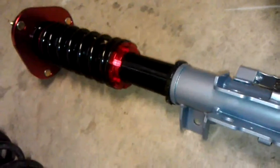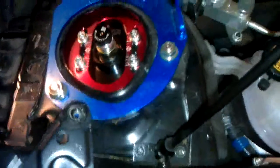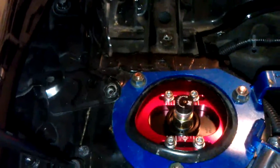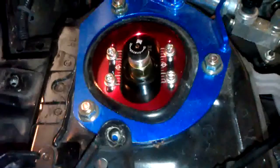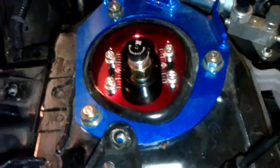What I'm going to do is hold this coilover, bring it into the wheel well, push it up with one hand, try to get it into these three holes, and put some nuts on it so it can be held there. The only thing you have to worry about is orientation. This is the installed one — it's the front of the car. The allen-controlled bolts should move left to right when you install the coilover because you're adjusting the camber. I'm not 100% sure about this, but I Googled some pictures of the pillow ball mounts and that's what they look like.